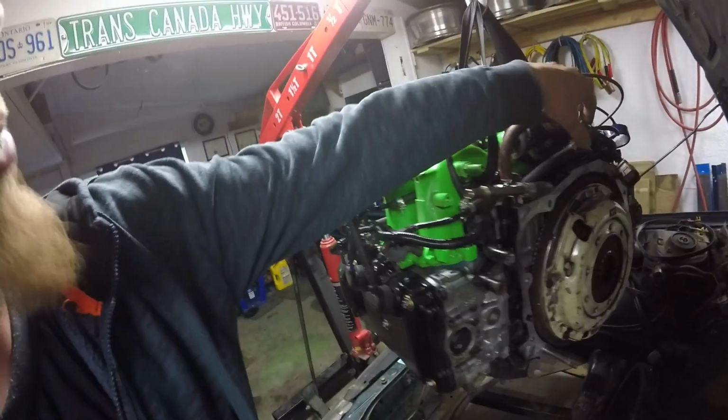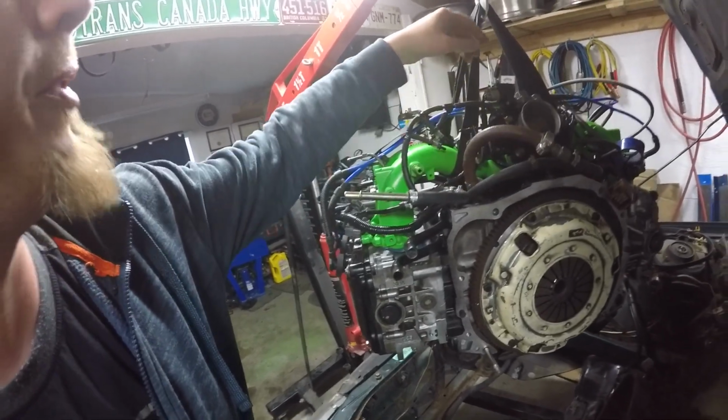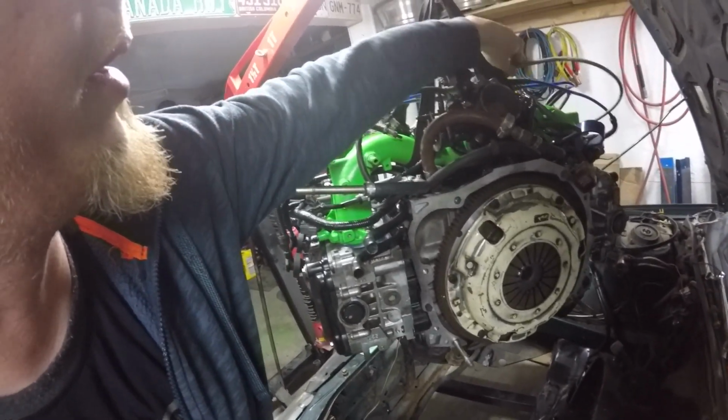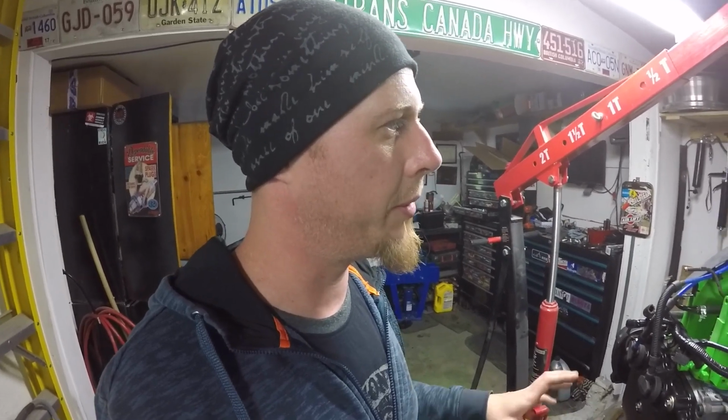without the turbo. I'm going to plan on bypassing the coolant lines, just putting them together, and then the oil feed. I think I'm just going to put a bolt through the banjo fitting and then use some copper washers and a nut and bolt to hold it all together. So the line will have pressure, but it won't spit out of there. Might leak a little bit.